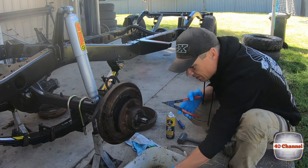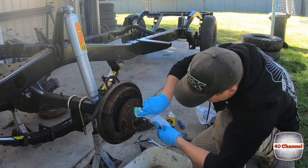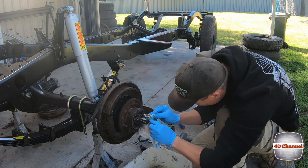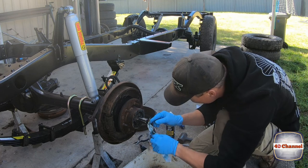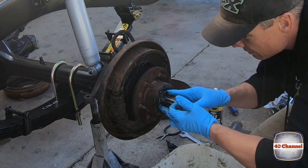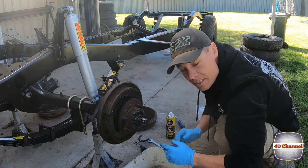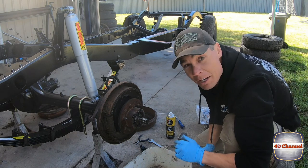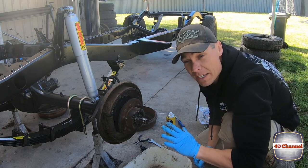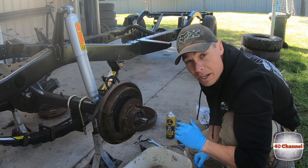Slide all that straight off and give it a quick clean out, just a wipe over so we can find what we've got. There's a locking nut on here — there's no movement in my bearings whatsoever, so it's in really good condition. But that doesn't stop me replacing everything new, because being such an old vehicle and not knowing the history, I have no idea when it was last done or what condition it's in until we pull it apart.